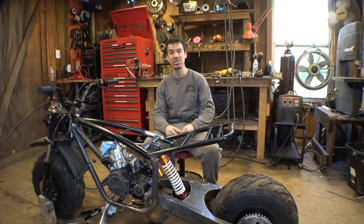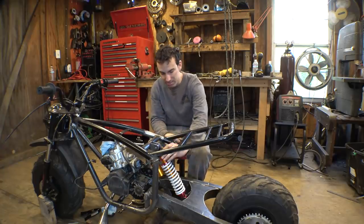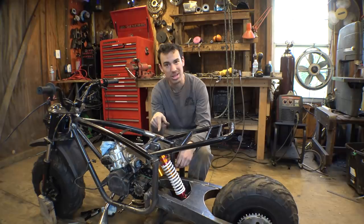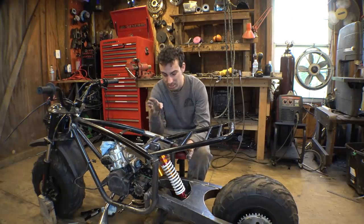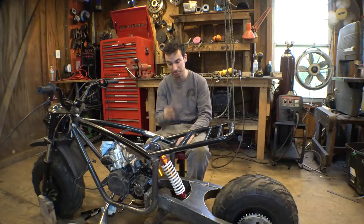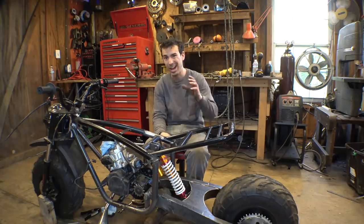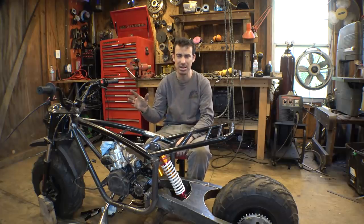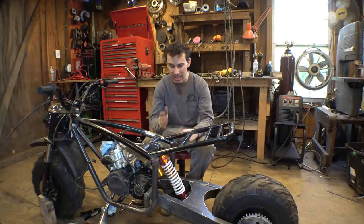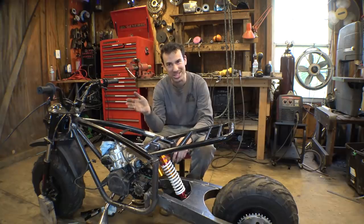All right. So I spent the rest of the day yesterday trying to solve the issue of the rear shock. I didn't film it, but I did move the spring tensioner all the way down, and because this is an air shock, I charged this up to 100 PSI. It was dead for some reason, so charged it up to 100 PSI, and it's a little bit stiffer, but still, it almost bottoms out when I sit on it, so that's not going to work. I started looking at other shocks that are the same length with a thicker spring. I couldn't find any. Not saying that they're not out there, but I couldn't find any. Started looking at name brand stuff, and they're just still, again, same spring thickness. So they really wouldn't work, plus they were almost three times more expensive.